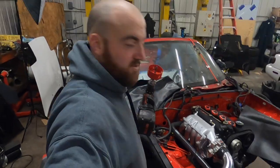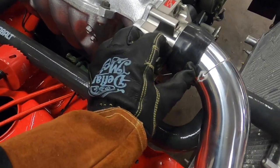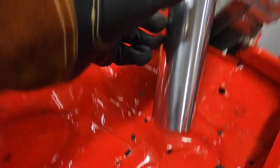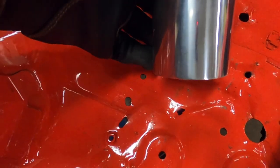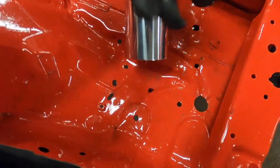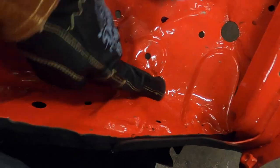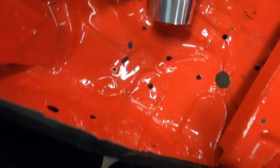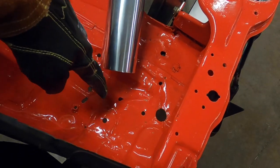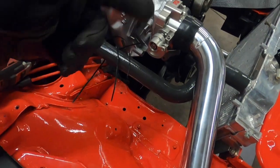So it is hole saw drilling time, which means this is all set up. This is just a shortened 2.5-inch coupler — there are the pieces I tacked together. This comes down to right around there, and this blue dot here is halfway between the frame rail, which runs right here, and the edge. I spotted it in the middle and it lines up with the intake hose. So I'm going to drill through that, then put the last piece on the bottom and install the IAT bung, which I have — so we can do that today.